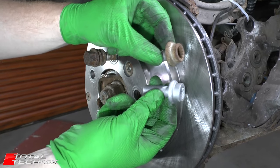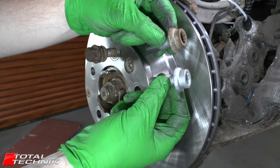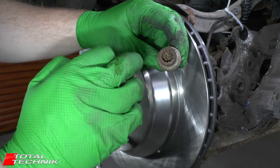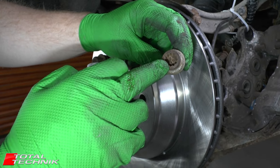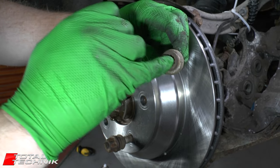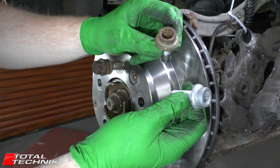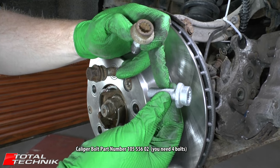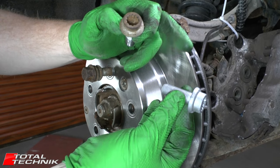As per the Audi/VW workshop manual, it's always a good idea — and the manual says you must do it every single time — to replace the caliper bolts whenever the caliper is removed. They're probably around five to seven pounds per bolt, about the same amount in dollars. We'll put the part number for the bolt for the Audi Q7 with rear Brembos in the description so you can reference that. Worth remembering: these are 12-point bolts and of all the types of fasteners, these are the ones that will round out most easily if you get bad corrosion inside. Always replace these whenever possible.